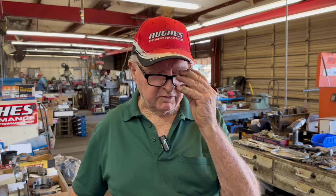So many times the Ford trucks, Sanderson Ford down here, I've done so many of those in the early ages. The 460 Ford Dually, yeah. Ford Motor Company had the camshaft almost 6 degrees retarded. And they want torque for those things. It would not spin the wheels. Right. But it saved the drive shaft and U-joints. But it wouldn't pull nothing. Right. It wouldn't pull a trailer for these farmers.